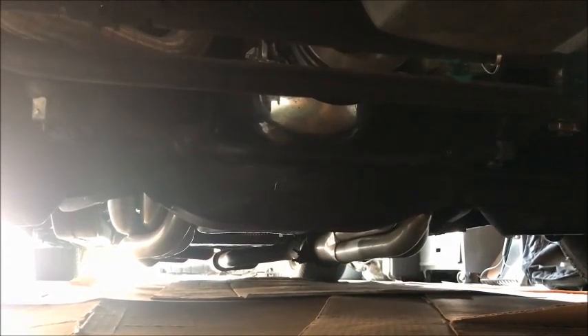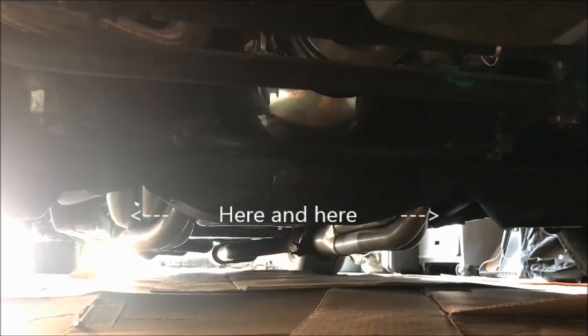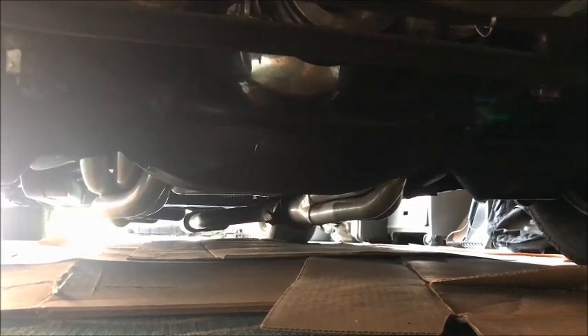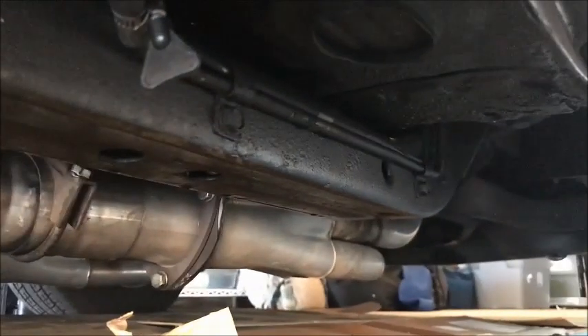When you jack up the car, remove your air dam if you have one on a Trans Am. You can see underneath my oil pan the cross member — jack it up in the middle of that, and then put jack stands on both sides so when the car is in the air, it is evenly up. Put the jack stands in the middle on this cross member right there, jack it up, and then on the sides of the car put your jack stands on the frame rails. Put a jack stand on either side of this big hole.